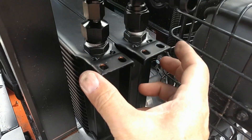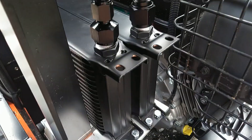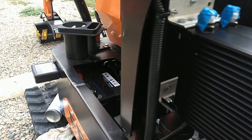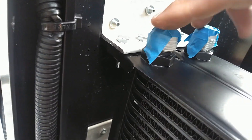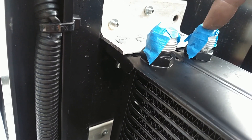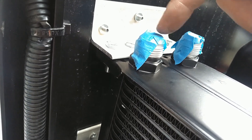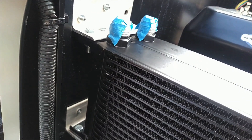I haven't really decided if I'm going to make a mount for the last corner because it doesn't line up, but I probably still will. When I took the fittings off, I put some blue tape over the openings so that while I was drilling, no metal shavings got down into these radiators. Just a heads up — I don't want any metal shavings in these. Alright, time to go to the next step.